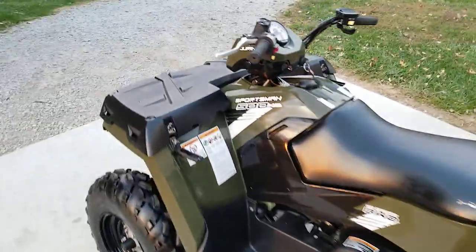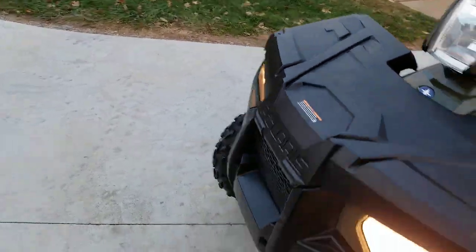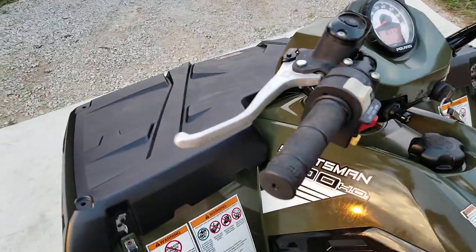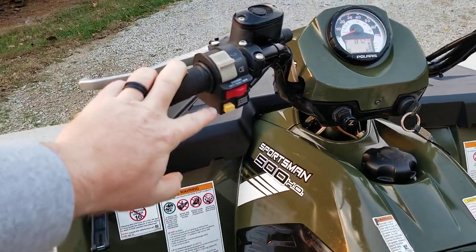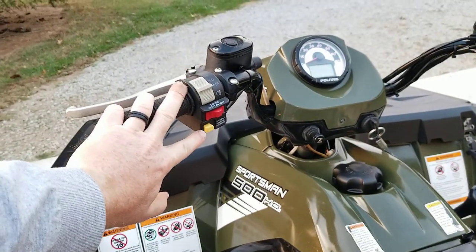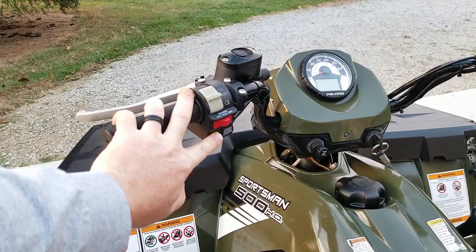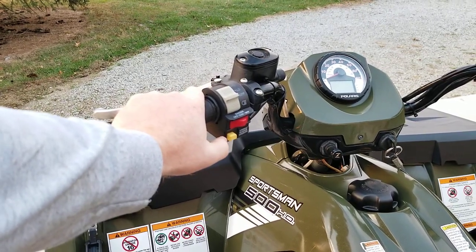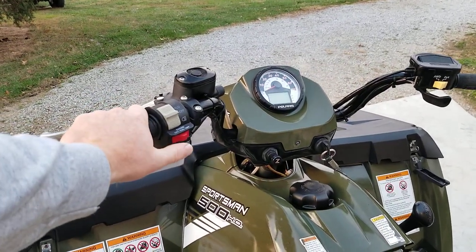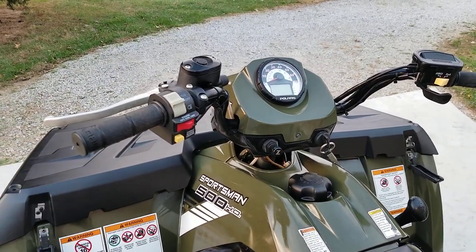You can see the brake lights work. With this one you've got the option of the top light — that's your bright setting. Your low beam is the bottom lights. Your controls are pretty standard, with your lights and your cutoff switch on the left, as well as your yellow reverse override. A lot of people don't know this on the Polaris's: if you're going backwards, your machine is going to hesitate — it's going to sound like it's stalling or there's something wrong. If you hold this down, you won't have that. That's a safety feature so you can't drive in reverse at 20 miles an hour accidentally by holding down the throttle. You have to have hands on both handlebars with that pressed in if you want any kind of speed. Also, you have to have that pressed in if you're in reverse and you want four-wheel drive — your four-wheel drive will not work in reverse if you don't have that pushed in.